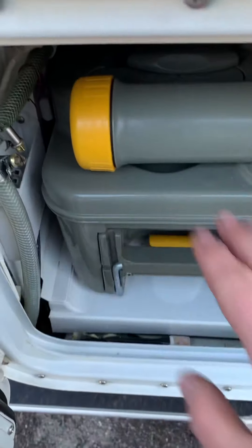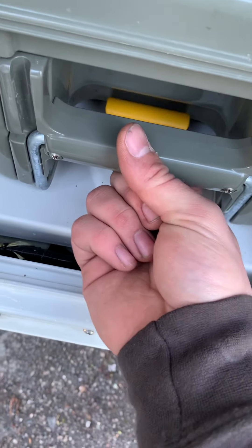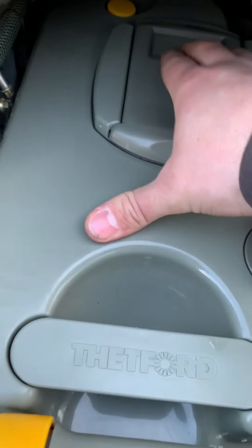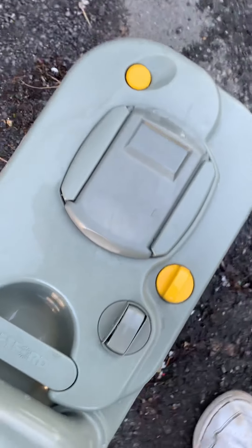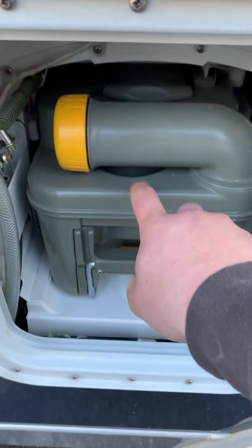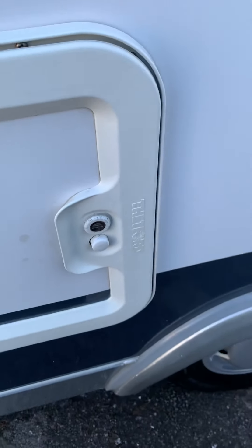The toilet — so that's a fresh water flush, so you don't have to worry about any separate flush area. It's just a case of lifting up on the yellow lever underneath and pulling it in towards you. That's all been lubricated — the old seal and everything. When you come to emptying it out, you should always hold this button down here — it's a pressure release valve, it lets it all come out a lot easier. That's all been cleaned and it's good to go. That's where you put your blue toilet chemical in — only about a cap full. To lock this one again, just put the key in, 90 degrees, and that's that.